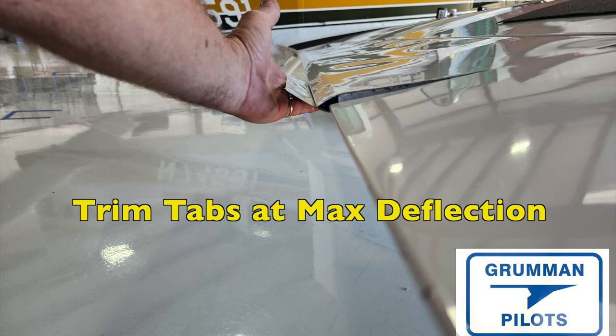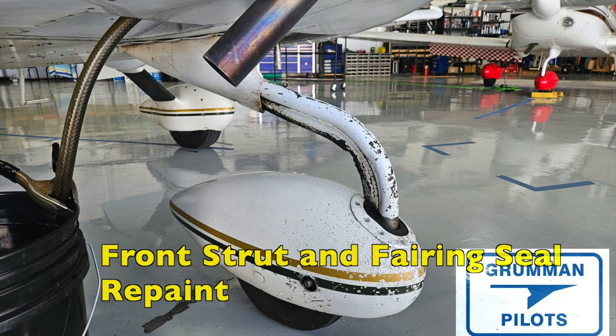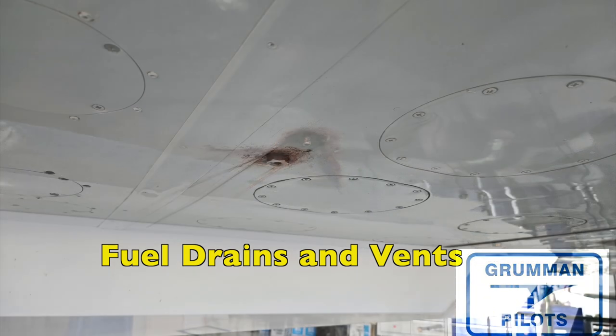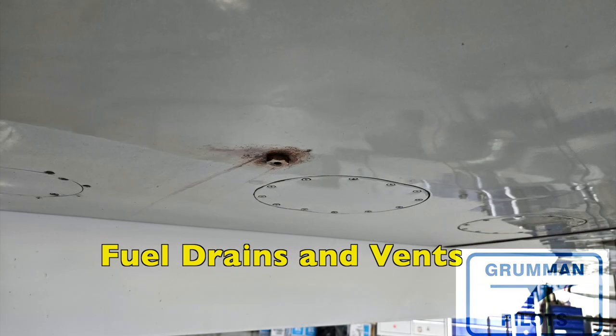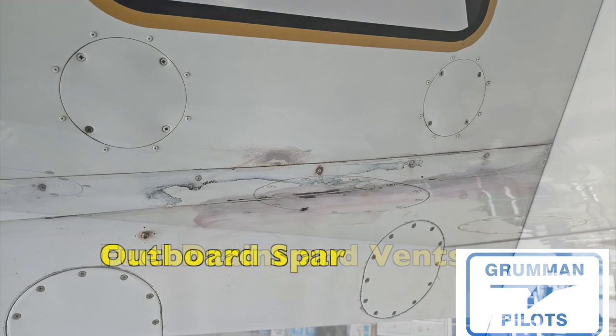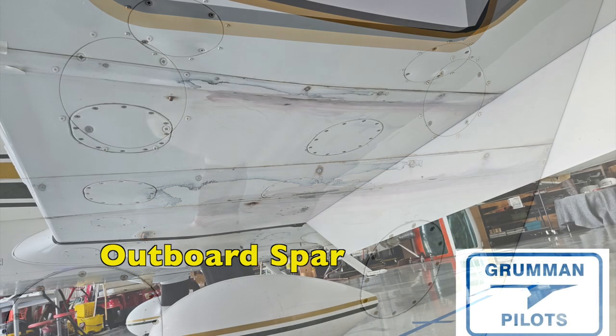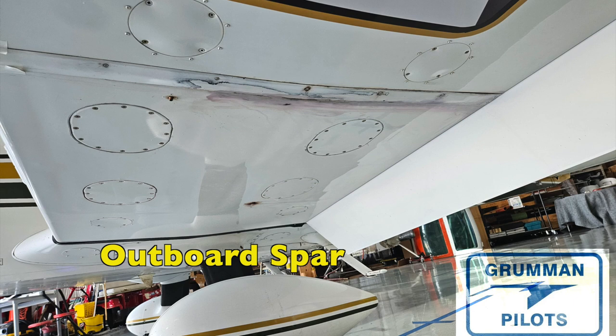The airplane was about six knots faster after rigging. The fairing ring and the front strut needed paint attention. This strut had not been pulled in 11 years — it did come out fairly nicely. We also investigated all the fuel stains on the bottom of the wing from the vents, and found a leak at the spar. All were within airworthy standards, but the owner decided he'd like them cleaned up, so the pictures you'll see later won't have all those fuel stains.